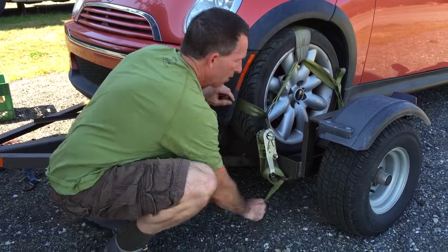You probably could leave it in gear, but that's just the way we do it. Very importantly, you've got to take the emergency brake off. You put it on to hold the car still while you're loading, but you definitely need it released before you take off. We've seen people dragging with it on — on dirt it's obvious because of the dust, but on pavement it's not so obvious, and a big coach often won't even notice. Next thing you know, your brakes and tires are burned up — it's a bad deal. I actually stop again before I leave the campground just to double check. With practice you can come together pretty quick — I can often load this in less than 10 minutes. Hope you found this video helpful, safe travels, see you on the road!